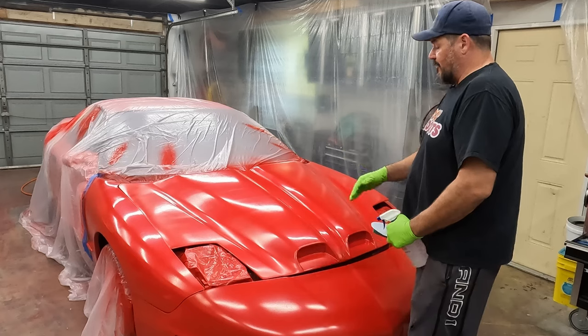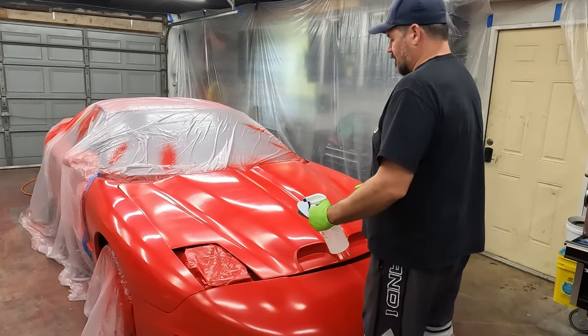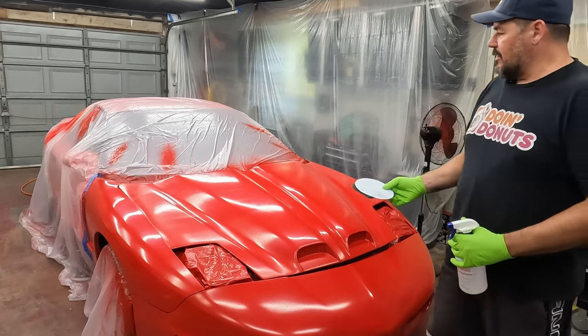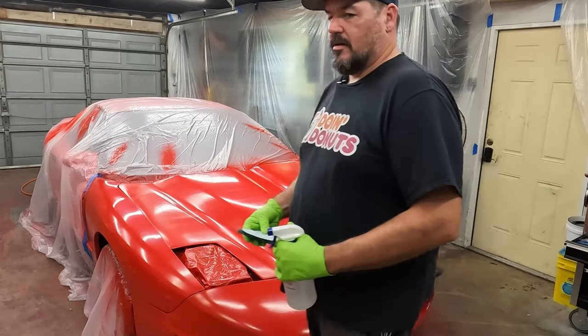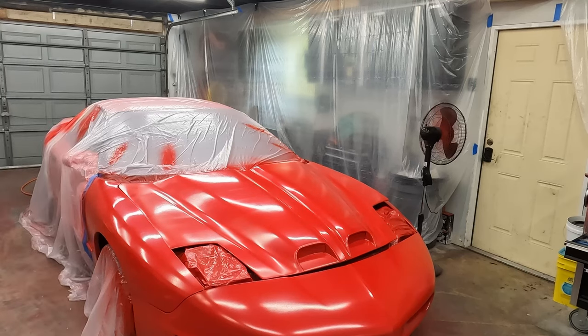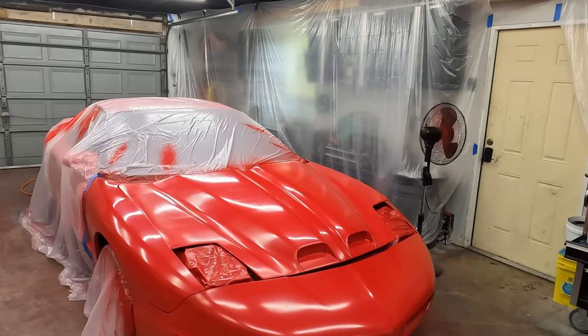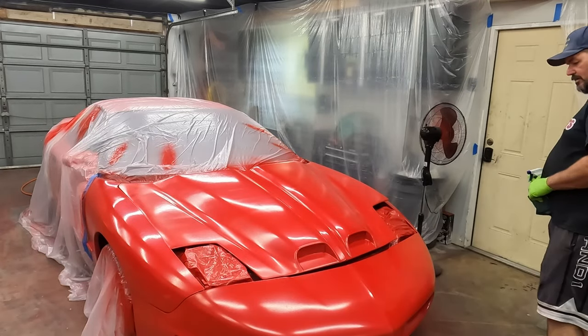But I'm gonna see if I can smooth that out, and be very careful, because I'm out of paint, so I can't touch up if I screw it up. I'm starting with 1,000. I actually think, just to be safe, I know you go low and then work your way up, but I'm actually gonna go up high. I'm gonna go 2,000. I'm at a little less risk of overdoing it. Maybe a little more, I'll do the bumper first.